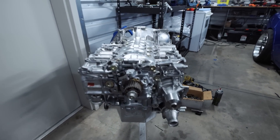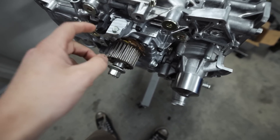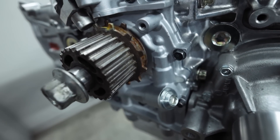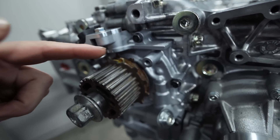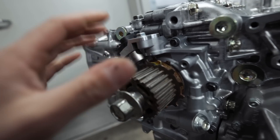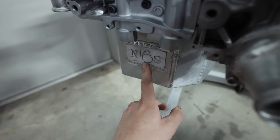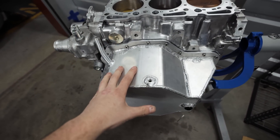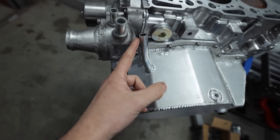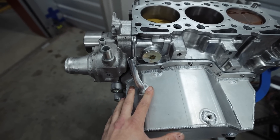I got to a good stopping point. I got the oil pump on, crank sensor on with our adapter — so I no longer need to run a modified crank sprocket. This adapter will pull the timing off the front teeth instead of the rear teeth, because if you just use an EJ25 oil pump on an EG33, it reads off the rear teeth and you need the front teeth. Water pump's on, oil pickup and baffle are on. I did have to modify this pan a little bit — I had to bend the oil dipstick tube because it was hitting the water pump, and I had to clearance the front of the flange to clear the oil pump.